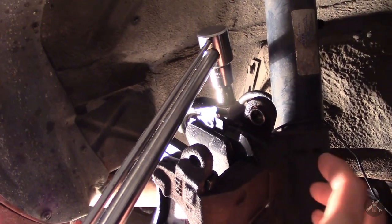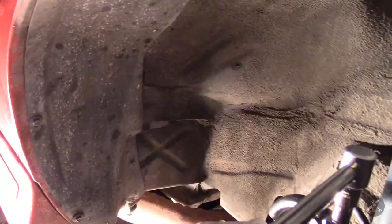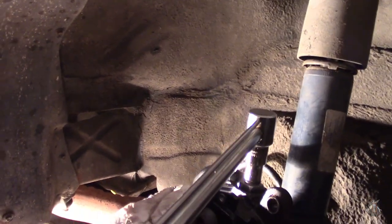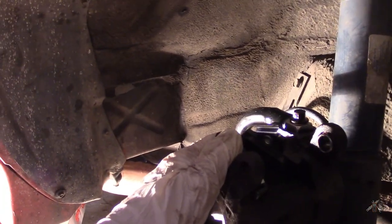I'm going to finalize where this sits and clip it after I get it tied into the caliper, which will take a couple minutes. This is kind of tight quarters. I'm going to see if I can get this bolt torqued up without putting the caliper back into its normal spot. If you don't get enough torque, you won't crush the copper washers. I'm close but I'll have to drop the caliper in and do it from underneath.